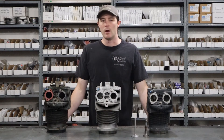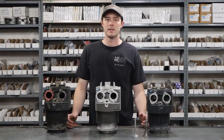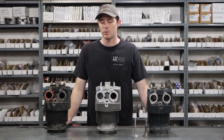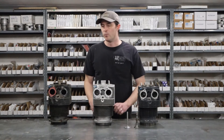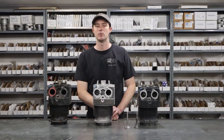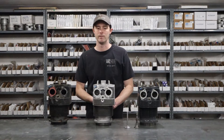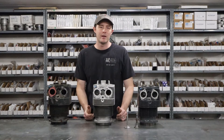We wash that off — it takes about three minutes to wash everything away except for what has penetrated into a crack. Then we rinse it with hot water, which won't wash away what's seeped into a crack but will wash away everything on the surface. Now using a black light, we can look at the cylinder and whatever green penetrant dye did seep into those cracks will show up as a very bright green light. That's how we know when we have a cylinder crack.